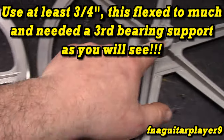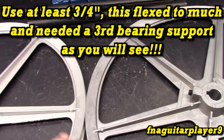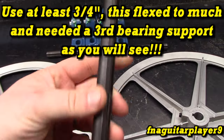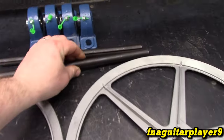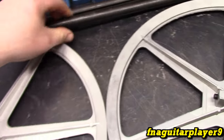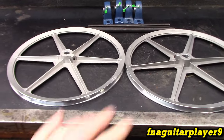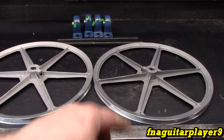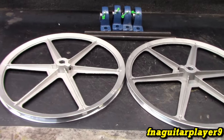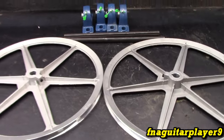These are all 5/8-inch ID - most of the big ones were 3/4 and bigger. These are actually jack shafts for a mini bike or go-kart, with 5/8-inch pillow block bearings. This video is also going to talk about cost. I had to order all this stuff from three different places, and we're right at $114 starting out - exactly $114 including shipping, tax, and everything. Not too bad.